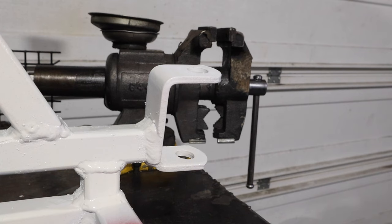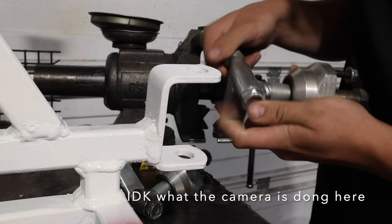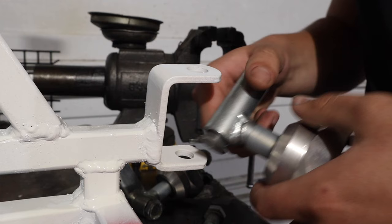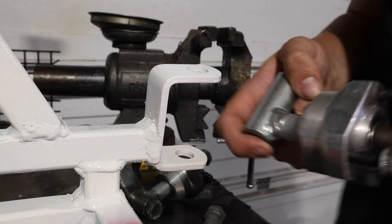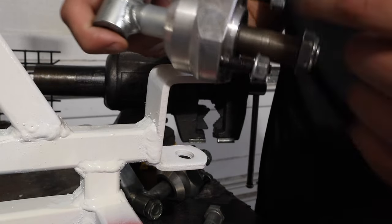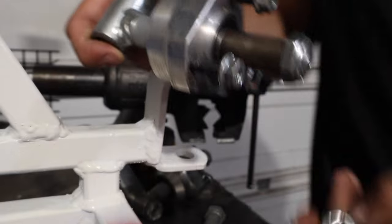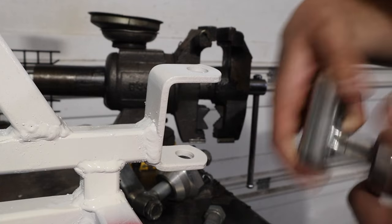Time to put the spindle on. So these spindles come with plastic spacers right here - I have no reason to believe they won't work; they kind of make me nervous, but I think they'll be okay. This spacer that I put right here is so that you don't have to crank down on the nylon nut for so long, because this is all-thread. So it's just a 5/8 spacer that you can buy anywhere and then cut to your perfect size.